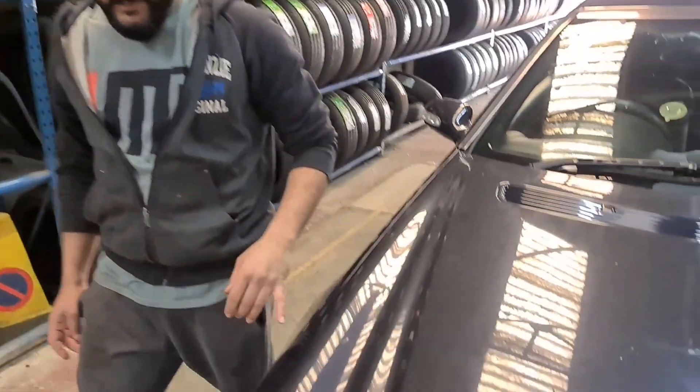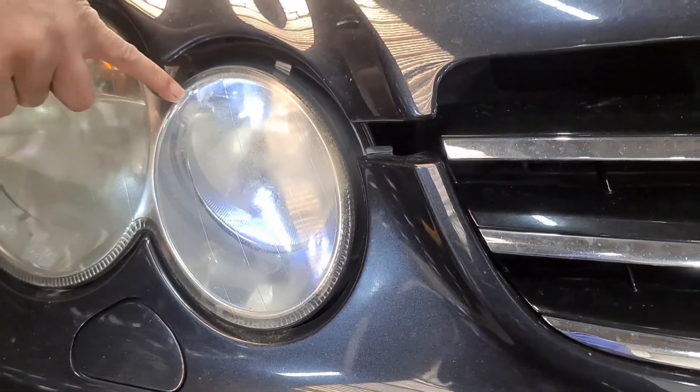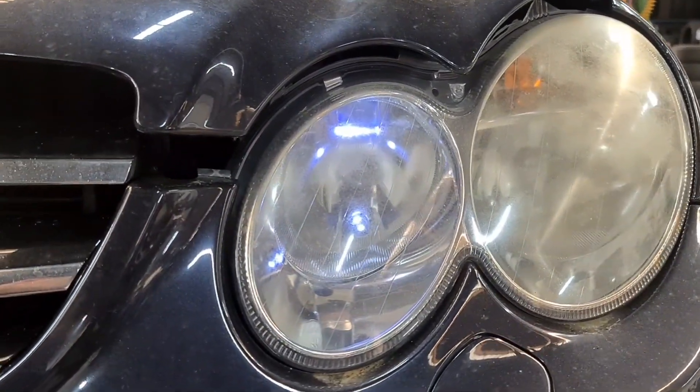The 501 bulbs — you can find them in the description or at the end of the video, I've got a link for it. Now you can see what I mean by the aftermarket bulb — you can see that's flickering. So it's sending wrong voltage to the car as well. And on the inside, on the dash itself, it's coming up with position lamp faults.